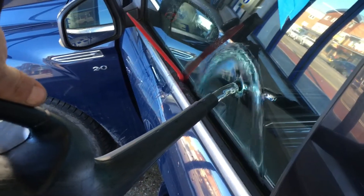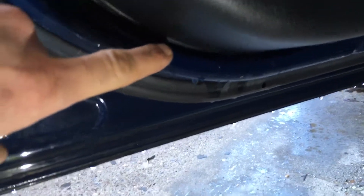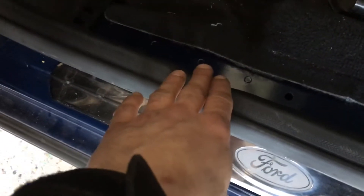If we put water down the back, it should come out the bottom of the door — which it is doing. But if we look closely, we can see water coming in through here. It looks like the door membrane is leaking on the passenger front, and it would then fall onto the seal and into the car.